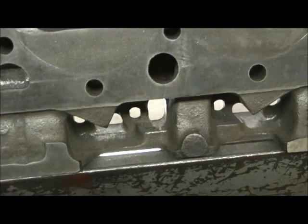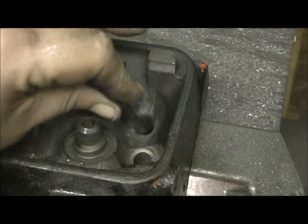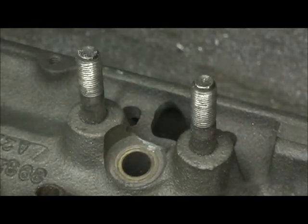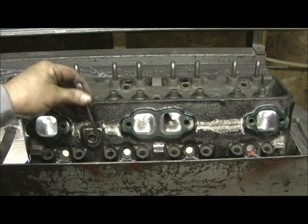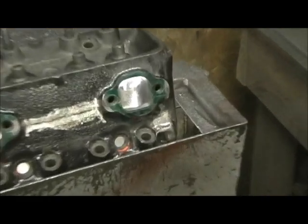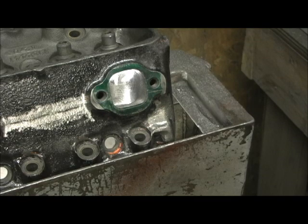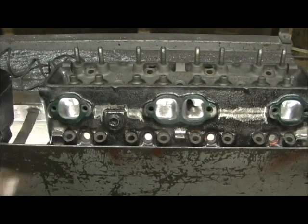Just stuff that most people really don't pay attention to. I take that edge, go in with a bigger bit, wallow it out, radius it, and cut all that meat out so it's got a real quick oil return hole. The head is practically done. I go in with the casting lines, knock off all the sharp edges, and blend the casting lines in. Right here on the corners there was a bunch of rough casting — I cut all that out and blend it so you can put your hands anywhere on the head and it won't cut you. I do a pretty good job of blending and getting the head ready. It just shows professionalism and that you care.